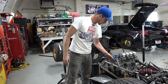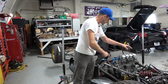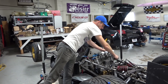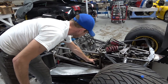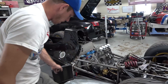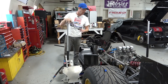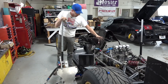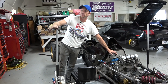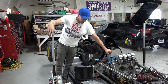The other side would be better but it's not feasible to change. So we'll run a line with a 90-degree fitting — instead of taking the theoretically shorter distance which goes right by the headers, we'll go around the backside of the motor where there's a lot of room and it's cool. Then it can make a gradual sweeping bend and do a straight shot right to the bottom of the sump tank. We avoid the headers, don't add much length, and avoid sharp bends — with the exception of the one 90, versus potentially two the other way. The oil system in a race car kind of has to be like how you drive one — fewest sharp bends, shortest straight distance to be efficient.